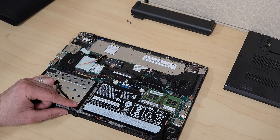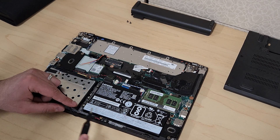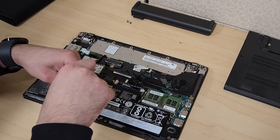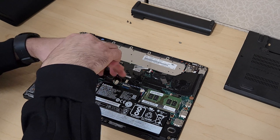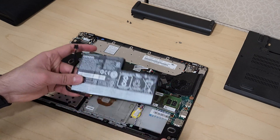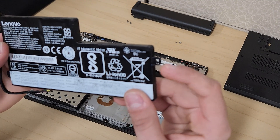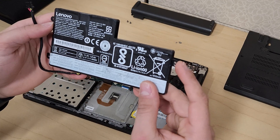To remove this internal battery, it's held down by one, two, and three screws. I just want to quickly note that you want to be gentle when you put these screws back on — don't overdo it because the brackets are very fragile and they can break. Be very careful because you can actually see how this tab here is a little bit cracked. If you over-tighten the screws, it will end up breaking these brackets.